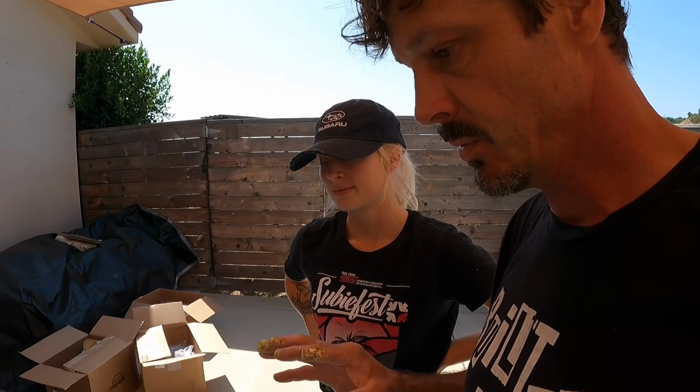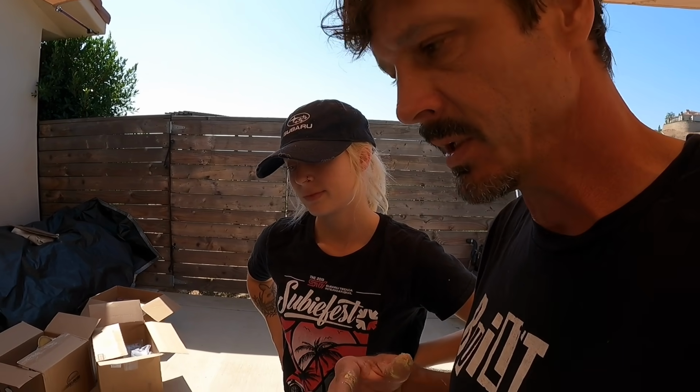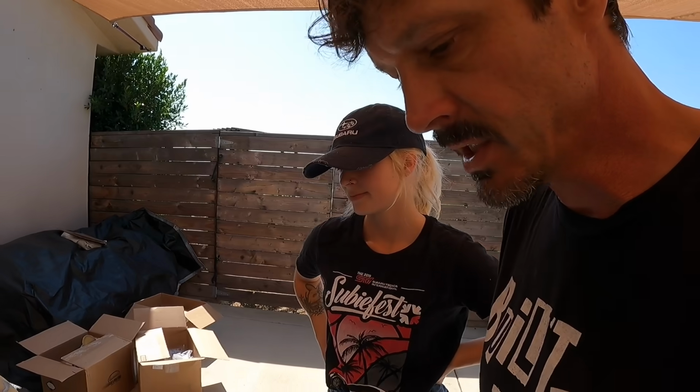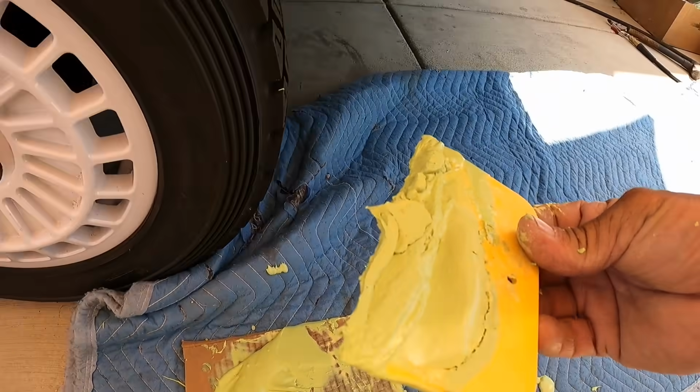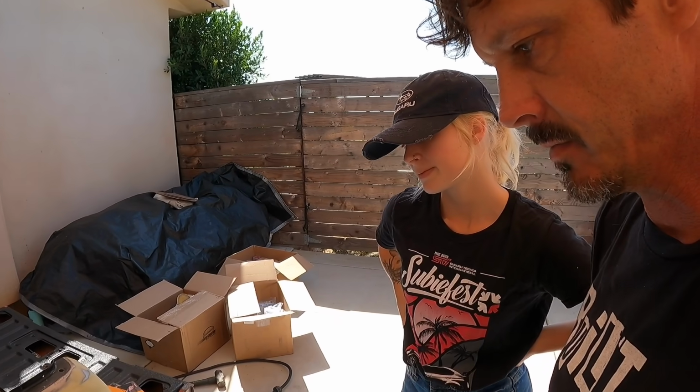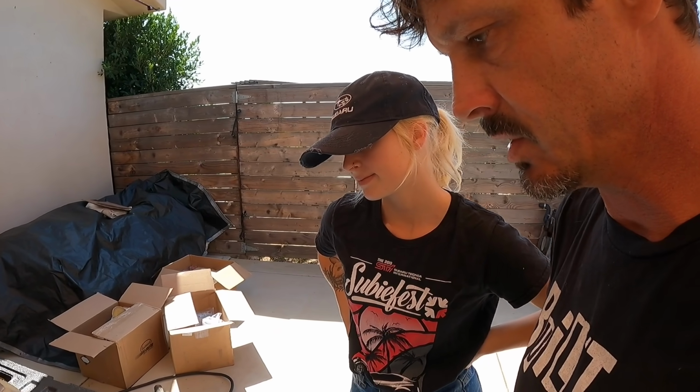And with the timing and the actual technique that it takes with such a big panel, if we were just doing door dings and stuff like that, it would be much easier. But with such a big space to cover, I think this is something that I'm probably going to have to address, and then I'll get you doing some of the smaller things like on the doors and on the hood and everything, because we wasted a lot of material. So we'll sand this down and I'll do a nice skim over this stuff, and then I'll get you on the blocking tip. Sounds good.